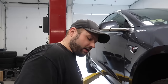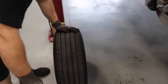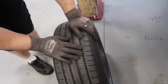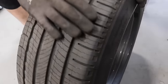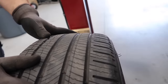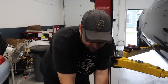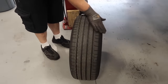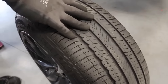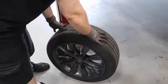Chad, what tool are you using? A Milwaukee. So what's wrong with the tire? These tires look pretty good, however on the front the inside edge is getting feathered. You can see they're actually lifted up this way — that indicates a toe issue. Instead of going straight down the road, the tire is slightly out, so it's scuffing the inside edge. The wear crosswise is pretty good, but this one is definitely a toe issue. We're going to have to do an alignment on this car.